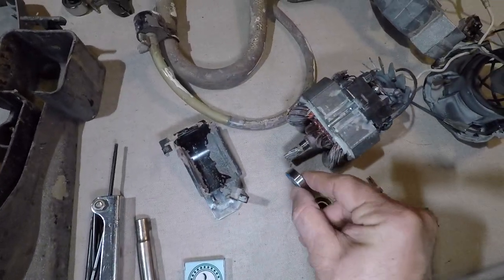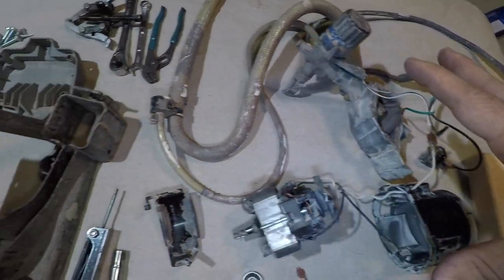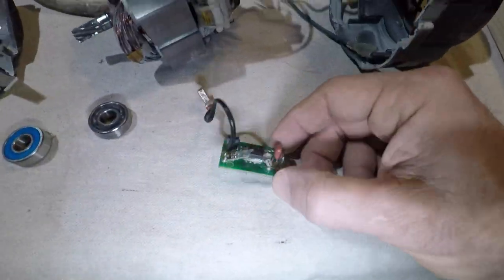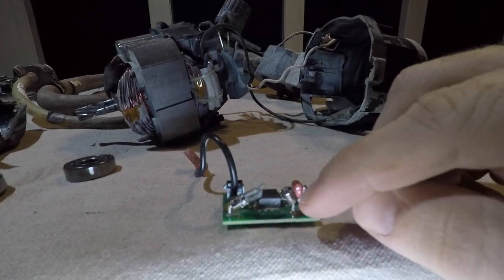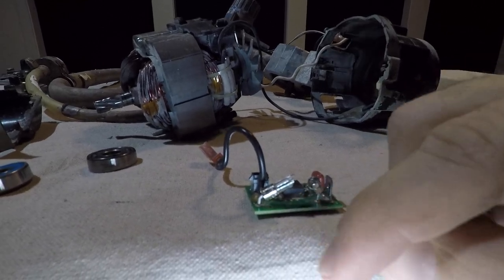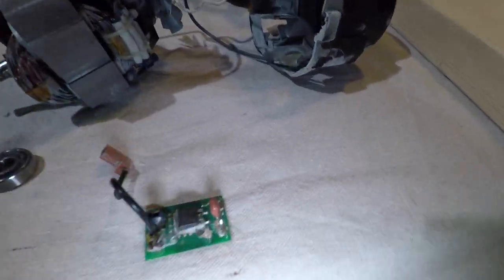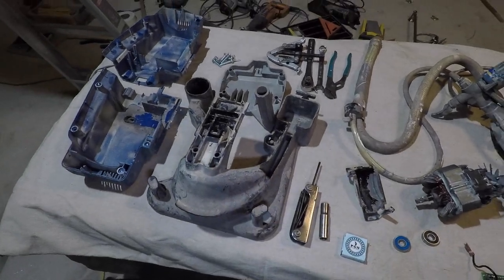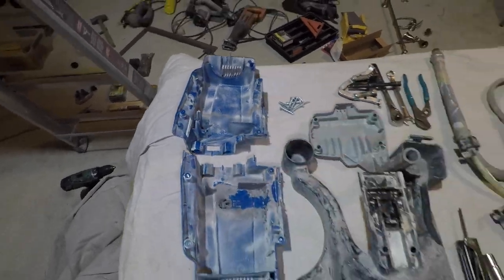What I need to do is press this onto the shaft, then put the motor back onto the pump, and then get it all back into the housing. For the fuse, it's soldered in right here, so what I'm going to do is cut it at the fuse holder and solder in an inline fuse holder so I can replace it in the future if necessary. I'm still waiting on that part, but I'll get everything else put together now, and as soon as that part comes in I'll show you how to mount it in the last spot and we'll be good to go.